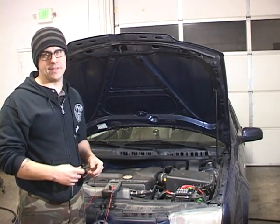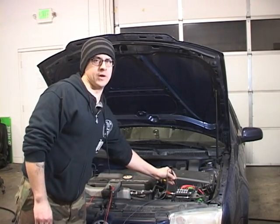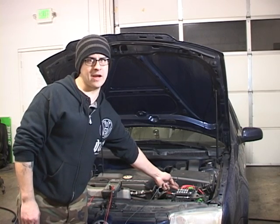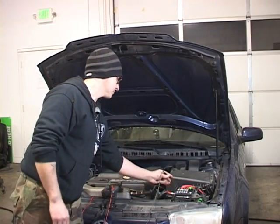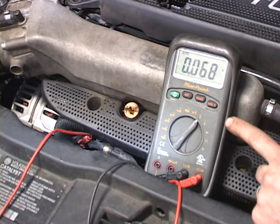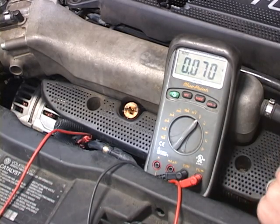After you've checked how much the alternator is putting out, now we're going to see how much voltage we're losing over the charge harness — to see if it's creating problems. Touch the lead to the alternator cable at the main fuse box on top of the battery. That's the rightmost cable — furthest towards the passenger side of the vehicle. As you can see, we have about a 0.07 volt drop across the positive charge harness. While that's not very much, as the vehicle heats up and loads continue to draw over this cable, it can easily increase to a volt or a volt and a half or more. So we want to write these down and continue on.